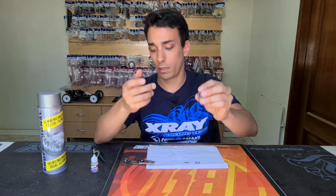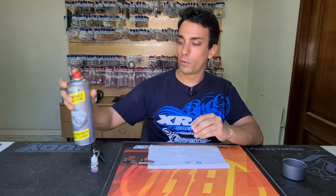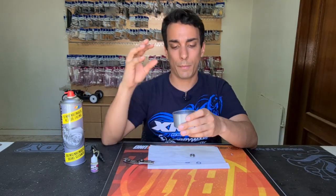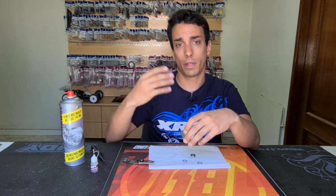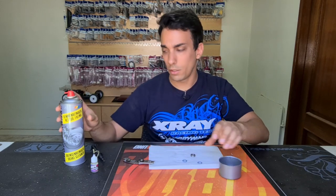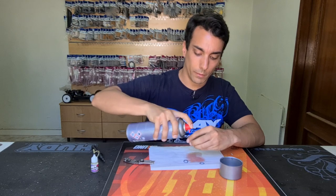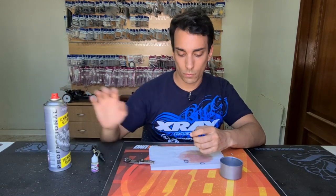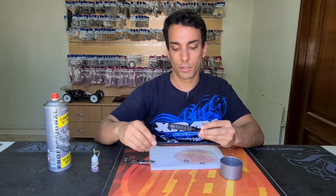It's full of grease, which is very good. Now with brake cleaner — I normally use a cup, put all my bearings inside with the covers, add brake cleaner, and let them soak so it removes the grease. Here I'm just going to do this one bearing to show you. We're going to try to remove the grease, and as you can see, the bearing is already much freer.